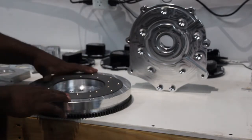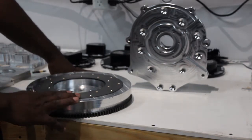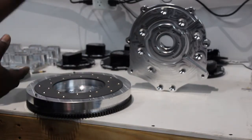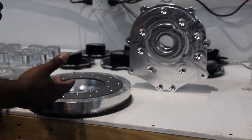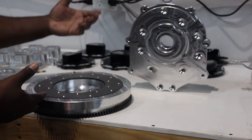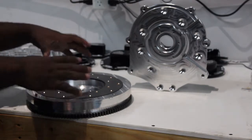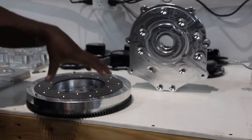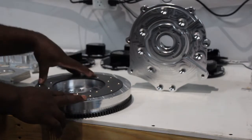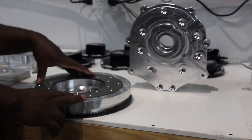Now the flywheel — what's special about our particular flywheel is all of our flywheels are built to be a hybrid where they'll mate to your motor, but instead of having to mix and match combinations of different pressure plates with a different model altogether, clutch disc and hodgepodge with a different flywheel to get a complete clutch flywheel combo to work, we actually make flywheels with a proper height that use CD09 clutches. All of our flywheels allow you to bolt up a standard 350, 370Z, G35, or G37 clutch kit.